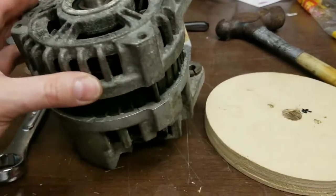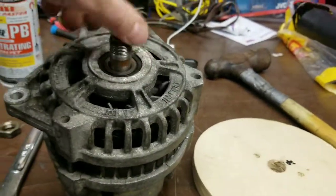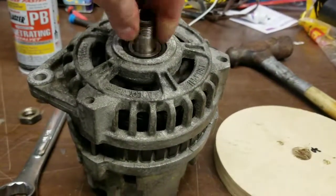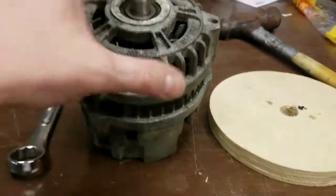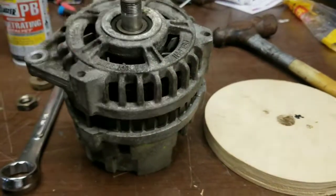Fast forward a little bit — all I did from that first video was put the screws back in once I got it rotated. You'll know if you messed up because when you try to spin your alternator it will grind. Essentially what you've done is misaligned your brushes.